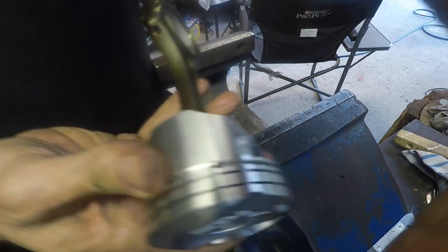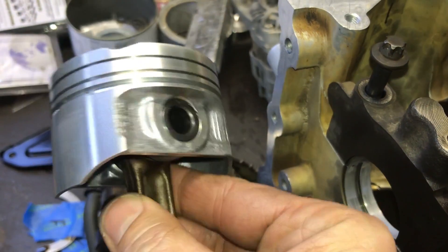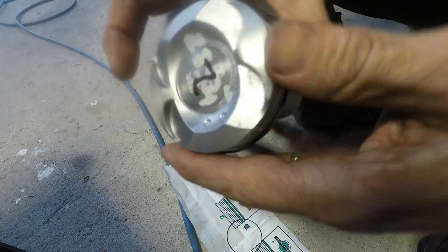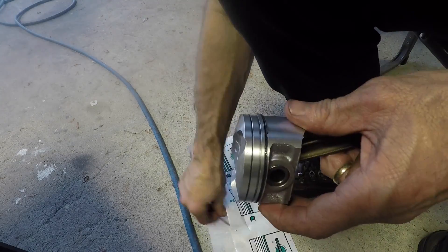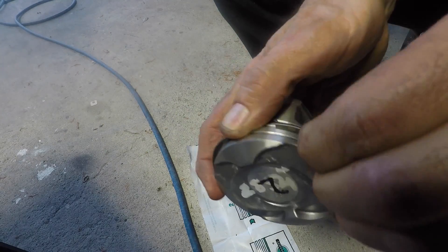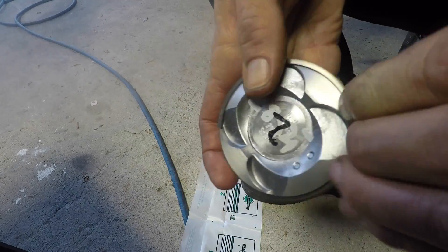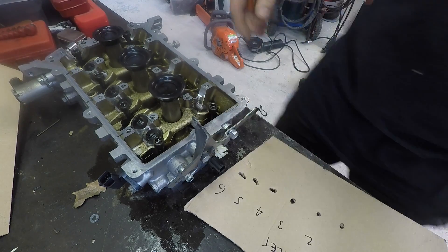Just check it moves freely. I've done this to all three pistons. Then I fit the new rings and measure the gaps beforehand just to make sure they have the right end gap — they're all good. The bottom oil ring has a separator ring and then two thin rings, one on the bottom and top of that. Then there's a middle ring and the top compression ring. I put all these in, and in the next video I'll show you the actual install, but this is just getting the whole engine ready to finally put it back together.